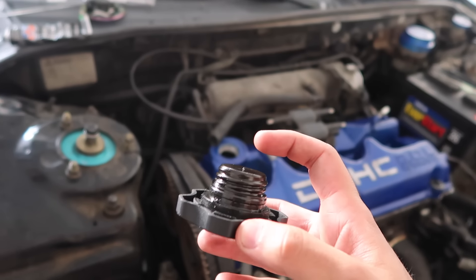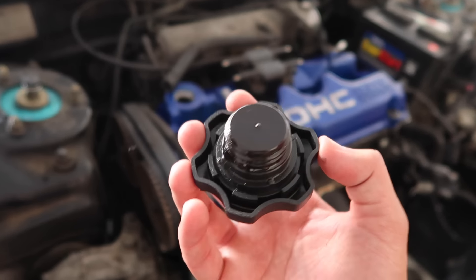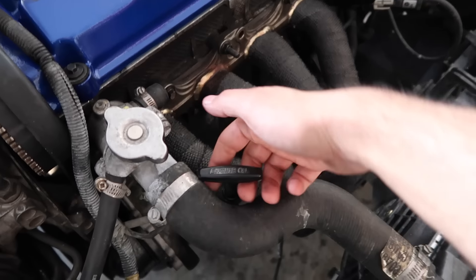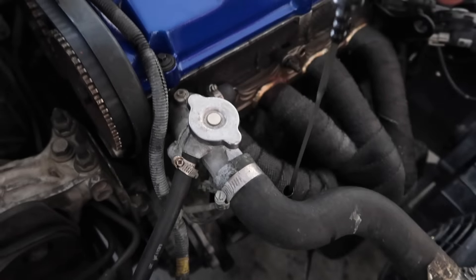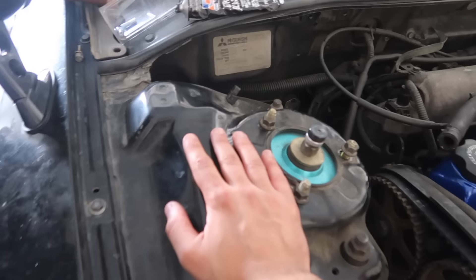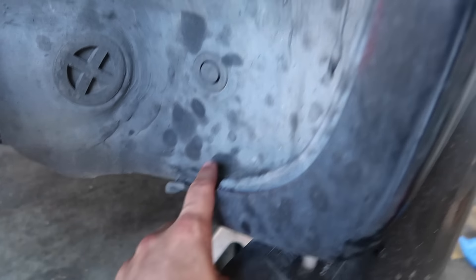Let's say you're out there looking at a car. Here's a basic overview of what to look for on the 420a or 4G63 in person. First thing you're going to do is take out the oil cap from the engine and make sure it's all oil and there's no milky, chocolate-milk-like substance — that usually means a blown head gasket. Then check the oil level using the engine oil dipstick to make sure the oil level is good.